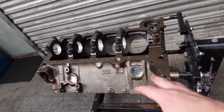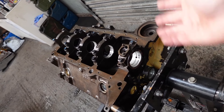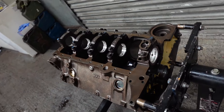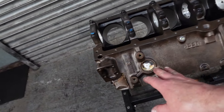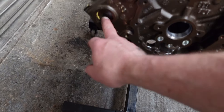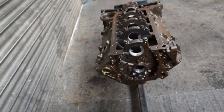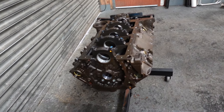Obviously the engine was yellow before. We didn't bother stripping the flywheel area because it's very difficult to get to and it'll be covered. We brought the whole engine down to bare metal — there are a couple of hard-to-reach spots like around the freeze plugs, but we got most of it. I sprayed it down completely with WD-40 so it won't rust. We'll get the engine to the machine shop to surface it.